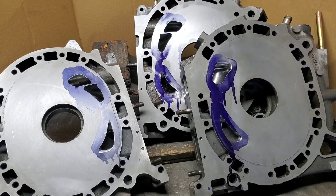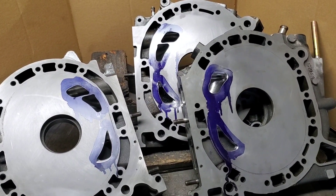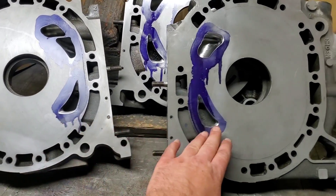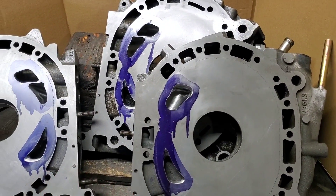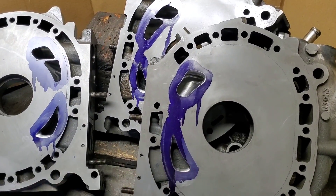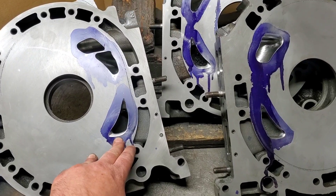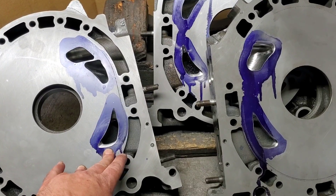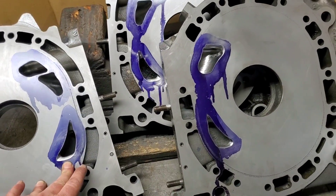It's going to benefit from better airflow. Rotary motors are no different than a piston motor — the better airflow you get on both intake and exhaust, the better the motor can perform. It's a well-known fact that RX-8s suffer from poor exhaust flow in their OEM trim. In this case, there was shrinkage around these exhaust ports, so the lapping was able to smooth that out. By porting the exhaust areas, even though it's a minimal amount of change, it's still a significant increase in the motor's ability to displace its exhaust heat.